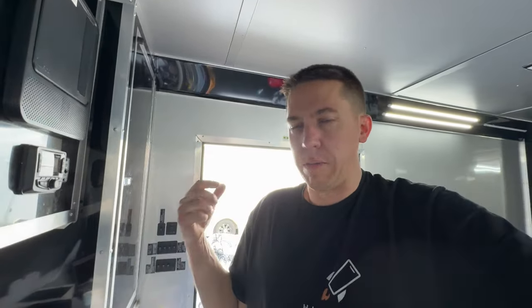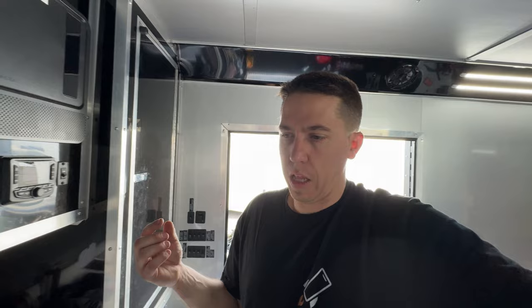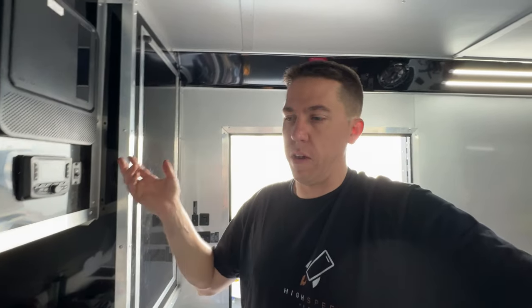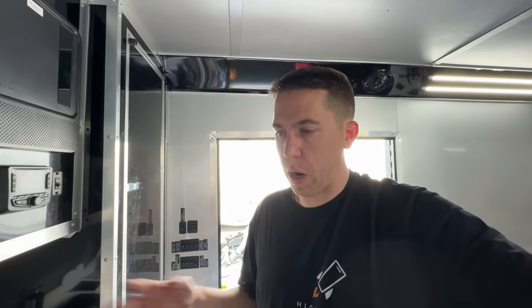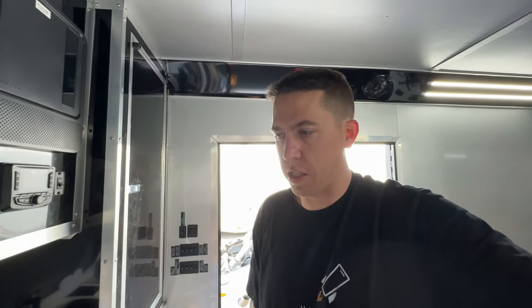The oil keeps coming from like the valley cover, and I don't know what the deal is with that. Cleaned it all up. It looks like it's coming from the valley cover. I pulled everything off, as you guys saw in the last video. Resealed everything back up. New gasket, new bolts, new everything, and it's still pushing it out. So I don't know if it's a crankcase thing or what's going on, but I got it cleaned up, and probably go out and make another hit, just see if we can go faster at 60, see if it carries, it looks good.